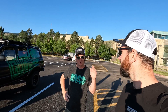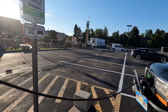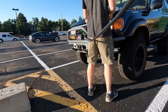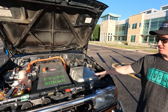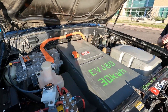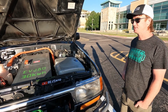Here with Jimmy Underhill, who's going to give us a deep dive into the electric Land Cruiser. He pops the hood to show what's going on — it's charging right now for a top-off. In the middle is the battery in the box, the charger, the inverter over in the corner, and the motor itself is down underneath the transmission tunnel. All the parts came from a 2017 Nissan Leaf.